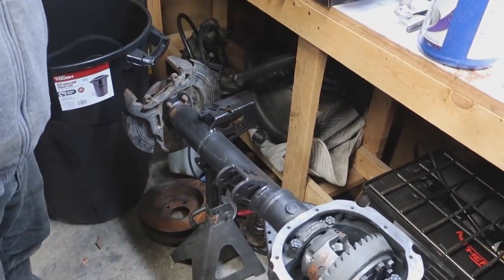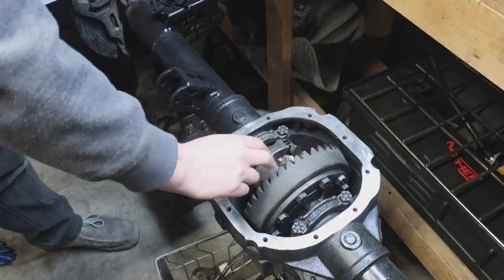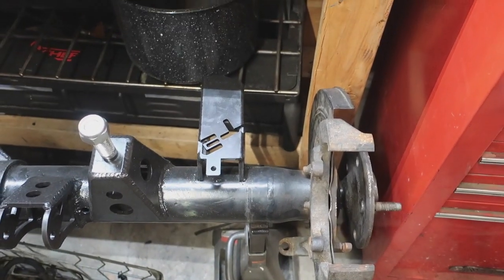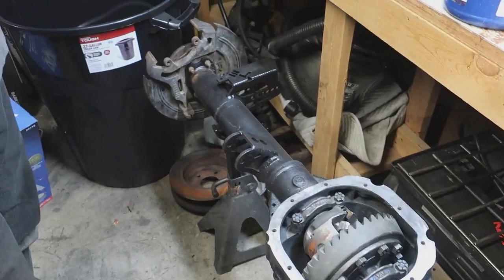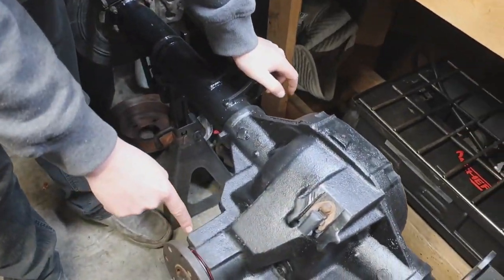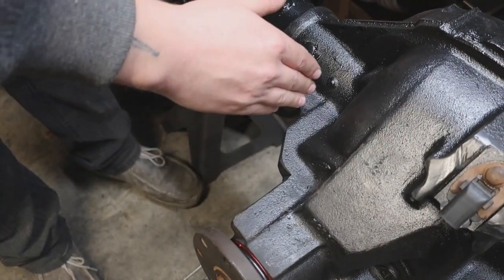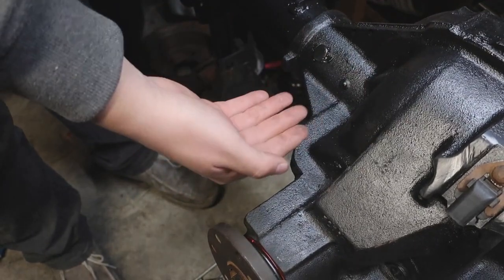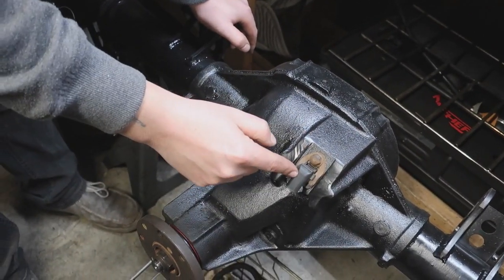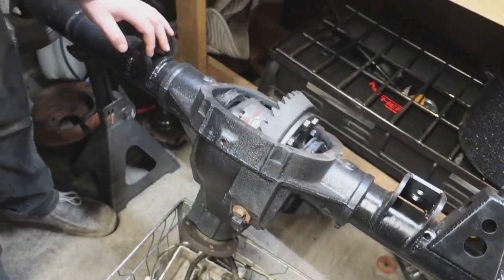All brackets are from T3. I didn't get any footage on shortening it or welding all that on, but that's pretty straightforward — you put a bracket on there and you weld it on. 4.5 ring and pinion. It does have the Ford TrueLock, and it's been shortened on the driver's side — two and seven-eighths inches or so. I test fit it and it's not a direct fit because of certain things Ford decided to do from the factory. It's been cut right here to mimic the other side; originally a big bracket came out that would hit the tunnel right where the pinion sits, and there were also two big pieces protecting the sensor. The sensor isn't needed in our car, but I'll get it on video to see how well it fits.